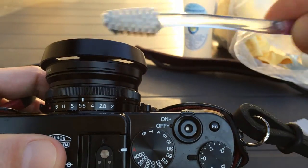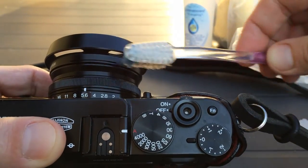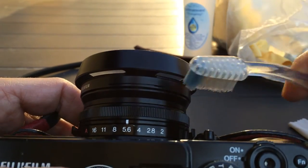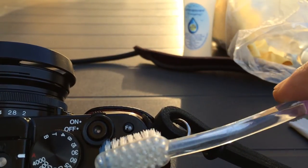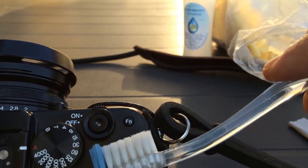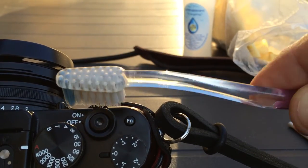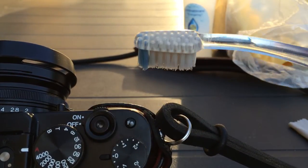What I usually do is just take my toothbrush and gently sweep the sand out. As you can see, it's coming out fairly quickly — just brush it to the side like this. Where we had a lot of grain before, we have no grain anymore. Please be aware when cleaning this area: if you have any grain of sand, do not use the toothbrush inwards towards the bottom. You'd just push the grains in under the switch — scrape it off to the sides instead.